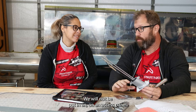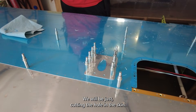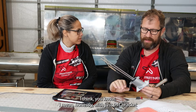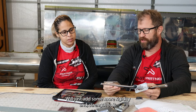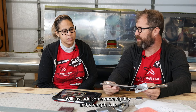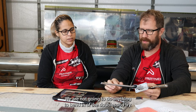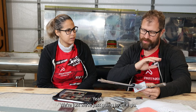The GAP26 is designed to mount on an access panel, but we will not be doing that — we'll just cut the hole directly in the skin. We've seen plenty of other builders do the same with a doubler. With just the bracket on the skin it's probably enough structurally, but a doubler adds more rigidity and strength. We're not going to do any fancy bending or riveting the doubler into a rib or spar — just let it go like it was on an access panel.